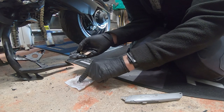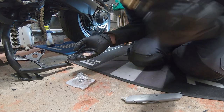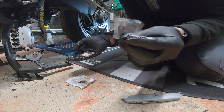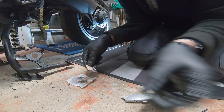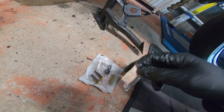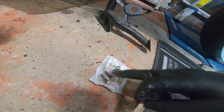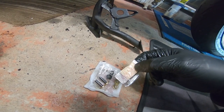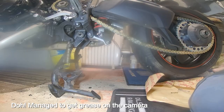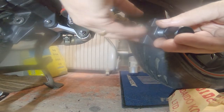I've got my O-rings — four of them — the plate that goes from the back to the front, the plate that goes on the front, the O-rings, and a little bag of grease. It's important that you get this grease on because the grease gets trapped inside the O-ring and inside the chain mechanism. If you didn't have that you'd get corrosion in there and this would become a weak link. It's a bit fiddly to show on camera but I will grease those up and pop them through the chain. Now the chain is ready to be riveted — that is in position A — I'm just going to slide it along, try not to drop that rivet off.